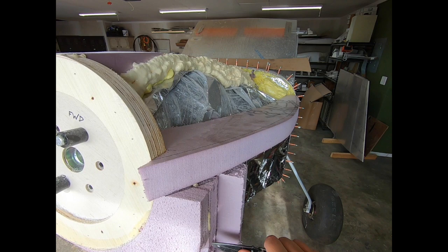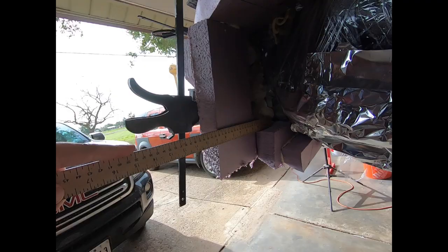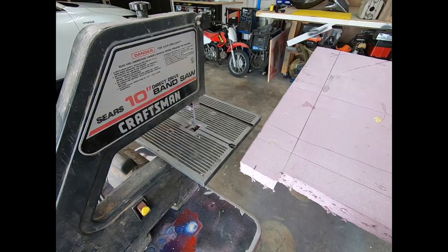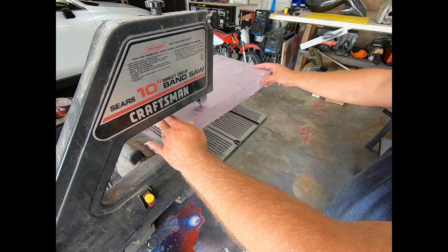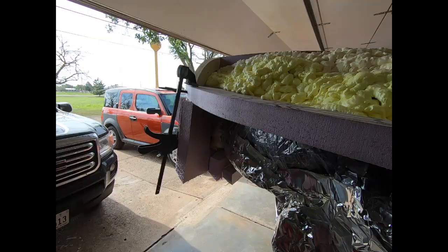I decided that I'd use the pink foam board on the lower portion of the cowl, since it would be hard to get the spray foam to stay where I wanted it. The top section I would do in spray foam since gravity would be on my side. I stacked up the foam board and glued a section in at a time and would move on to adding another layer of spray foam up top. You can't add more than a single layer at a time or it won't cure correctly and you'll have a messy hollow spot that you'll find later with the sander. Ask me how I know.